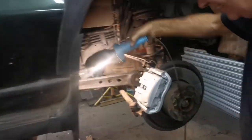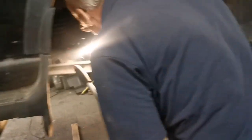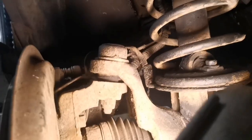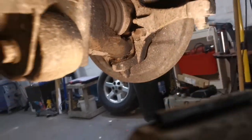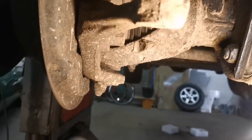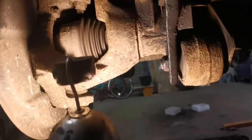The Discovery 2 — just going through the MOT on it, making sure that it's going to pass. We've seen that the ball joints on the hub here, on the pivot, are all perished. Now that one ain't too bad, this side ain't too bad, it's still perished. But this side's worse — that's completely missing off that one. So we're going to take these off and show you what we're doing. Please like and subscribe and help us build the channel.